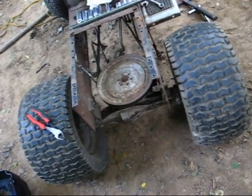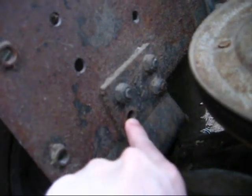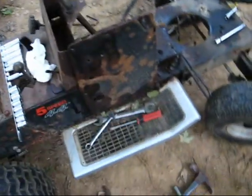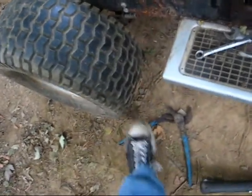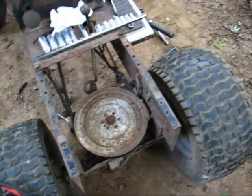For the transmission, I have some plans. I'm going to measure the distance and then drill another hole behind it so that the wheels can be moved back. This wheel here — the way that big deck is set up — when the deck gets raised up all the way, this tire rubs against it, and I don't like that. I'm thinking maybe I should swap out the pulleys for a smaller one. It'll make this thing go faster but it'll fit the belt size a little better when I pull the train back.